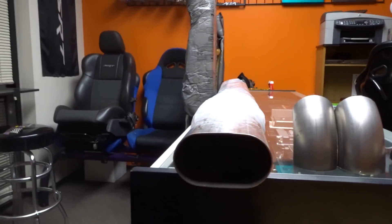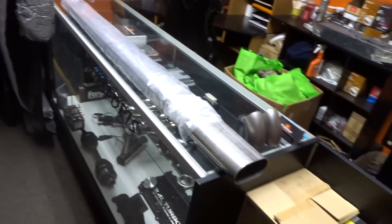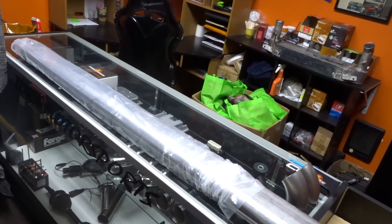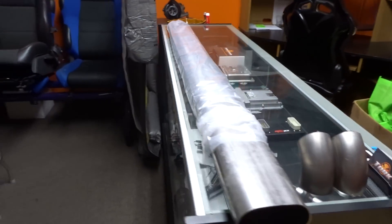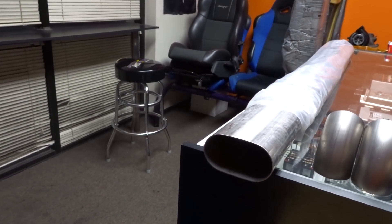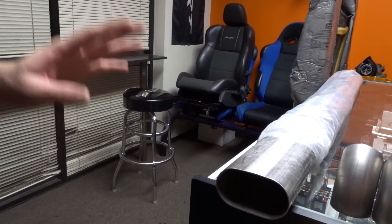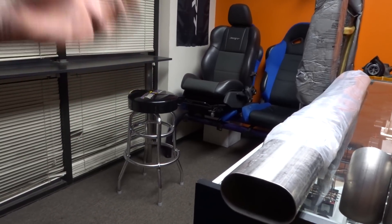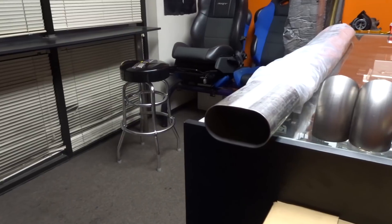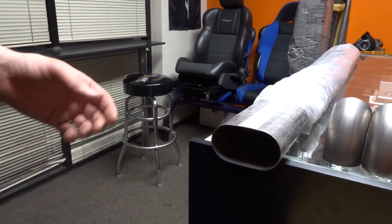What else do we have? Well, let's take a look at what we got over here — and that is a piece of oval exhaust. So what we're gonna be trying is oval exhaust in the midsection. If you don't know, we're already running the factory midsection and that factory midsection necks down to two two-inch pipes. What we're trying to do with the oval section is break up the V6 rasp, instead of running an X pipe or an H pipe. We're gonna run the whole midsection through an oval exhaust section — it's about four feet long.